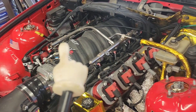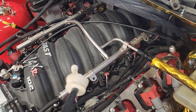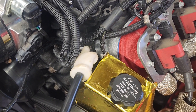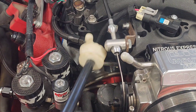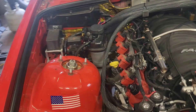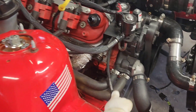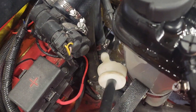I did put this hose here for the brake booster off the back of the manifold. I pulled the manifold off and got all of these steam port fittings hooked up — these guys here and the one back there and the one back there. They all go under here to the tank there. The nitrous line is hooked up, just kind of hand tight — not worried about that at the moment. All the hose clamps that I had just kind of sitting there, I tightened, and I put all these clamps on.